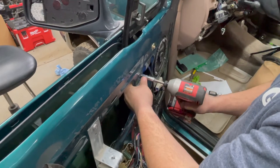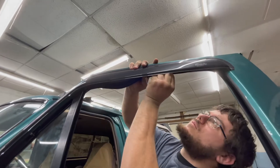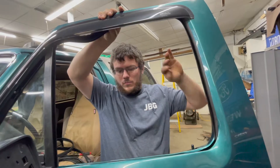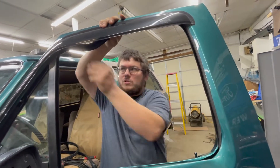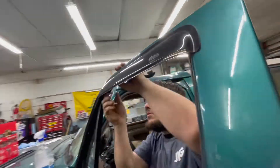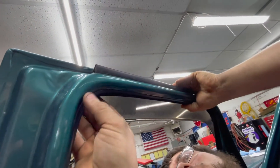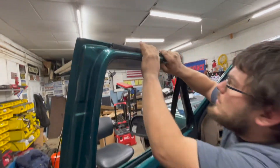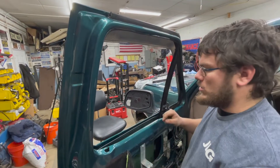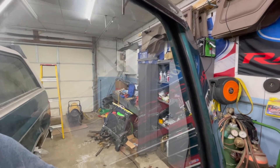Make sure it's in place. Now we're going to finish pushing the upper part of the seal into place. If it's too long, you can take and pull it down on one side and it will feed itself back down into there — you might have to reach inside and pull down on it a little more. Just make sure when you put the seal in that it's not folded up anywhere. The first time you use the window and it pushes all the way up, it'll smooth out any small imperfections you might have. Now I'll give the window a try — that's a nice, tight seal. Let's bring it back down.